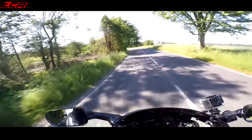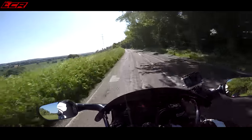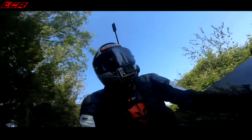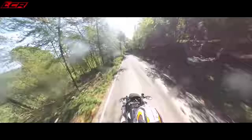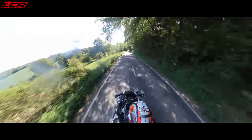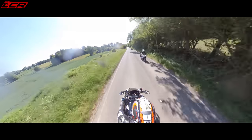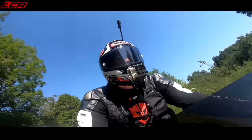There's a lovely feel to the front brake - you can just put a little bit of load on it and carry it into the corner. It's a little bit flat in the mid-range and it picks up about five and a half thousand. That's probably a fueling-related issue - you could probably pick up a bit more in that mid-range with another dyno session. But that's the trouble with dynoing one of these: you've got to take the carbs off, change the jets. There's no power commander, it's not injected - you're taking the tank off, stripping it down. It's a lot of work to get a carb bike fueling absolutely spot on.